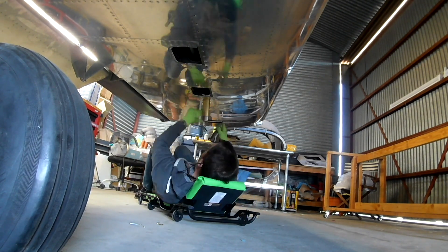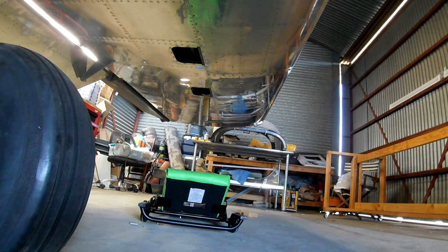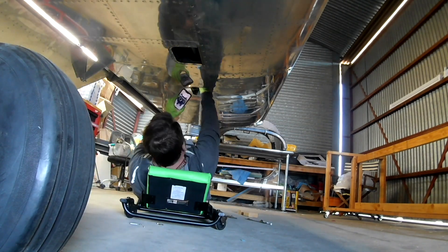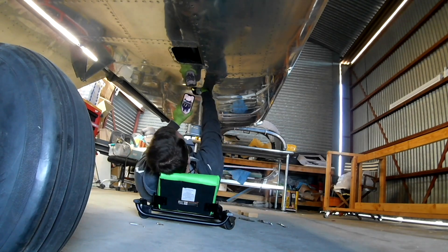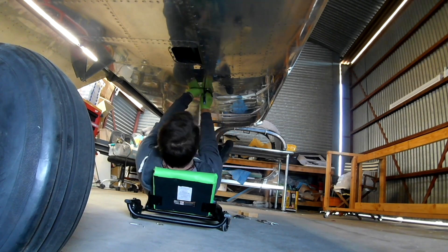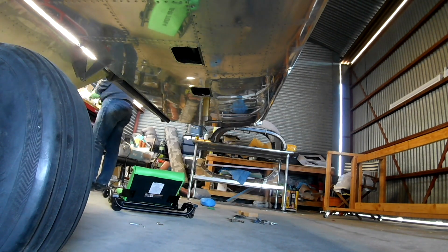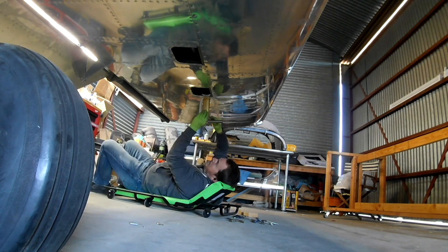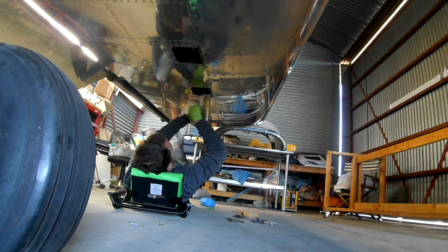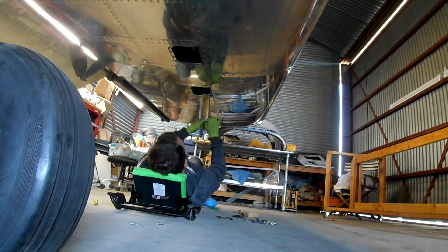We will connect up to two quarter-inch vinyl pitot lines. The quarter-inch vinyl is color-coded: clear is for the static, blue is for the pitot, and green is for the angle of attack. The pitot tube I have has a special angle of attack pitot chamber — it's basically just another pitot tube, but angled about 18 degrees down. So as you pitch up 18 degrees relative to your angle of attack, you're going to start getting more air going through that, and that triggers the angle of attack warning. All that in the fuselage is color-coded.